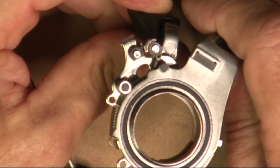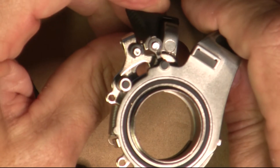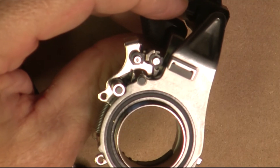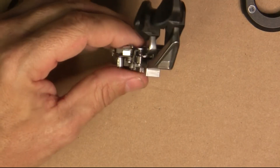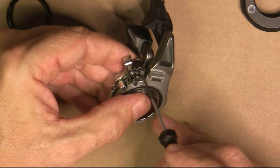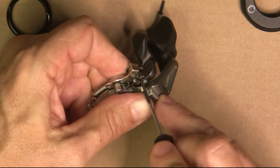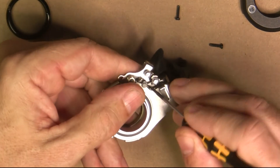It's a little bit harder pressure on the second click, which gives you that tactile feedback that you're going for two shifts at once instead of just one. There are also two torsion springs here - a little torsion spring that provides pressure to the clicker, and a torsion spring that provides significant pressure making the whole mechanism go up and down. The smaller spring just makes the clicker move side to side.